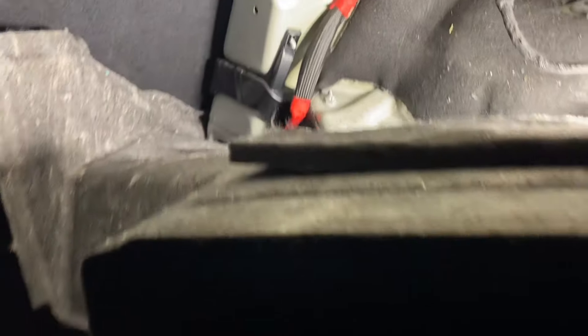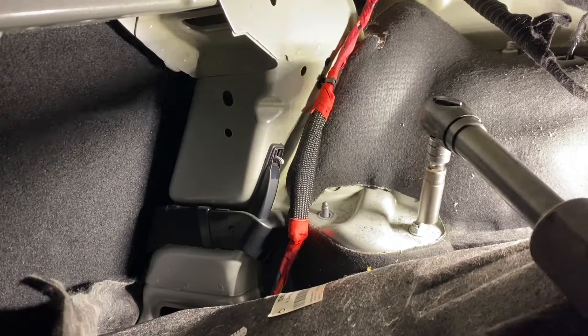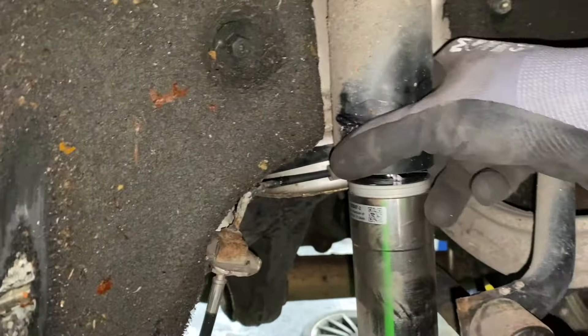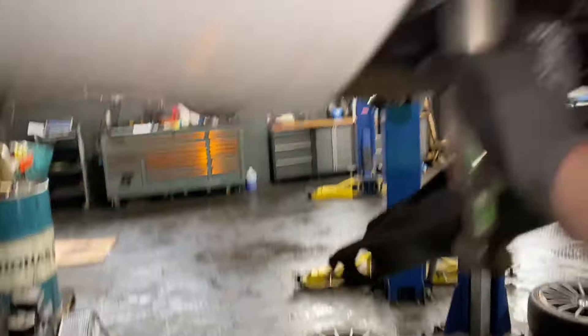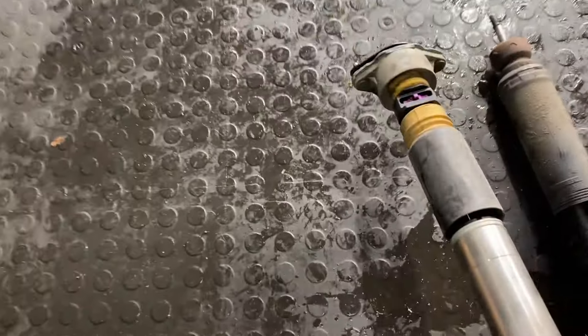So all the strut bolts go to the top. We're looking around here - took the carpet down, couple of trims, clips, and then those are the two nuts that we need to undo and then that shocker will come out. You can see it goes above that carpet so we're going to have to take out a load of ten mil bolts to just give us a bit more access so we can take that out from behind. Shocker out - trying to film this with one hand, difficult.